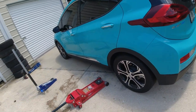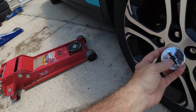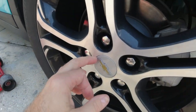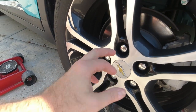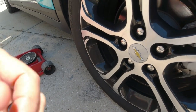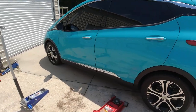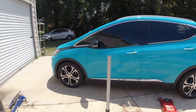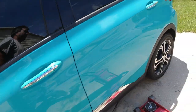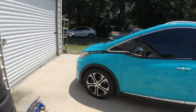So what I did was go out and buy some replacement caps that are black, and those are going to go right in there. To get those off you can probably pry them off, but the easiest way is to take the wheel off and just punch it out — it just taps right off. I bought these a while ago and saved them for this job. I'm just going to rotate the tires, taking the back ones to the front and front to the back. It's been a while — they still have some meat on them, but the backs have a lot more because the front tires spin a lot when you're driving.